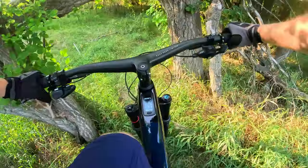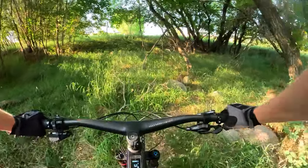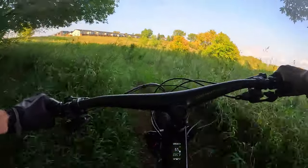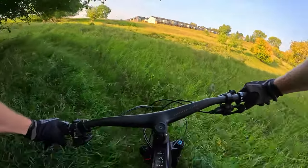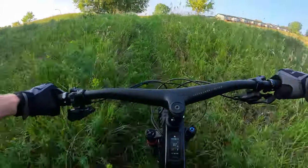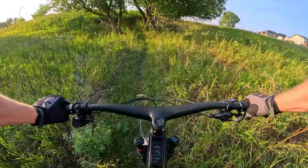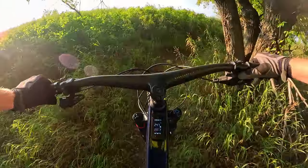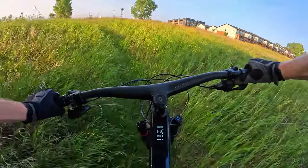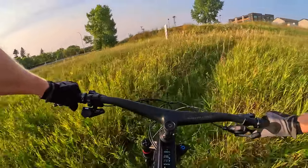It comes with a 34-tooth max and a 30-tooth minimum on the front ring, but comes stock with a 32. I don't know if you'd really need to change it. With an e-bike, part of me sees a lot of people wanting to upgrade to a 34 to get a little more top-end speed out — you'll naturally be up those speeds anyway with electric assist. Seatpost-wise on the Fuel EXE 5, it has a Trans-X 34.9 seatpost — a little chunkier, a little thicker. It goes up and down super nice, significantly better than those early renditions of the Trans-X stuff.